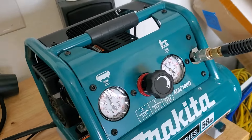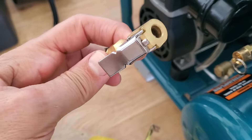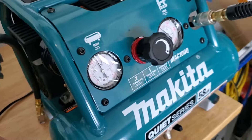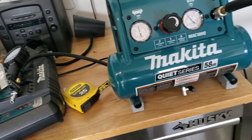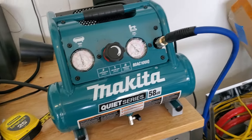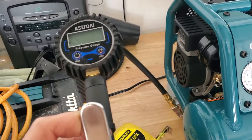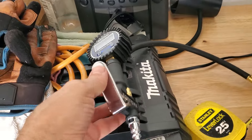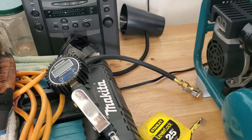I also picked up this gauge that shows you the pressure right away. I really like that too. It's got a quick-connect tip on it which you just slide on and it bites instead of trying to screw it on, which I like. This quick-connects to my little Makita compressor and bang — my 50-foot hose. It seems to be quite accurate because I tested it with two other gauges I've had for years and it seems to be dead on.